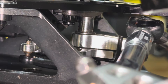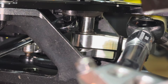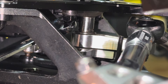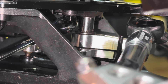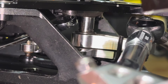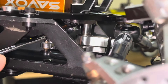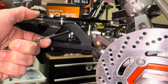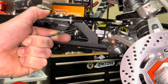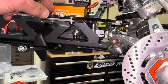You see this nut right here - I decided to put a high nut on the bottom of this symmetrical steering arm, and it's a nice lock nut. That way Angel won't have to worry about any Loctite for this right here. You can get to it simply by using an 8mm wrench, sliding right here like this and then tightening it on the top. That is a solid steering setup - super tight and right.